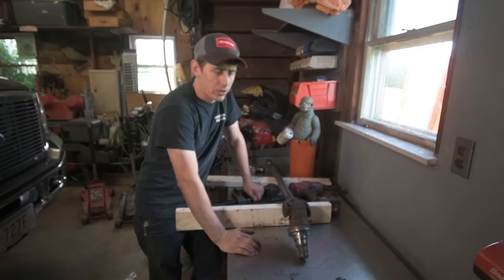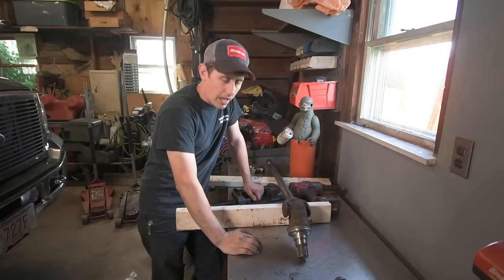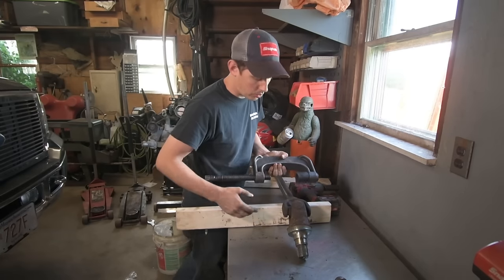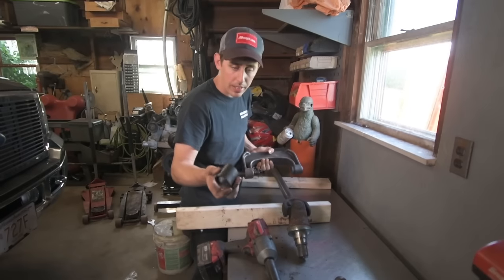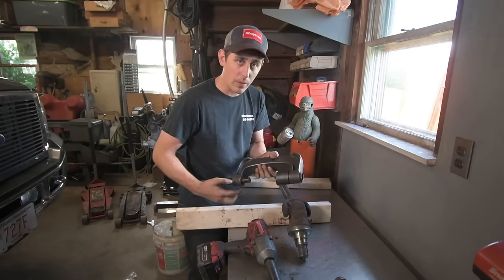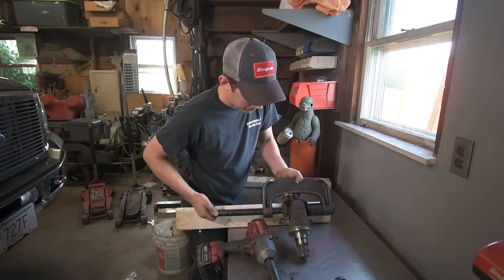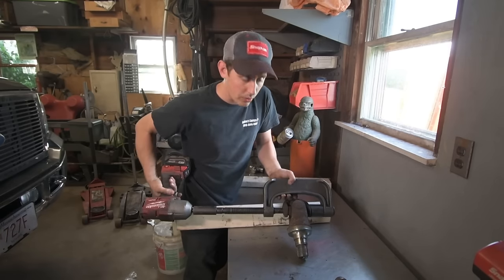There are a few different techniques to swapping out U-joints. Everybody has their own way, but my personal preference is to use a ball joint press. So what you do is use an adapter that the U-joint cap will fit through, put that on this end, then you just use the round end of the other side and tighten that up and start to push the U-joint right through.